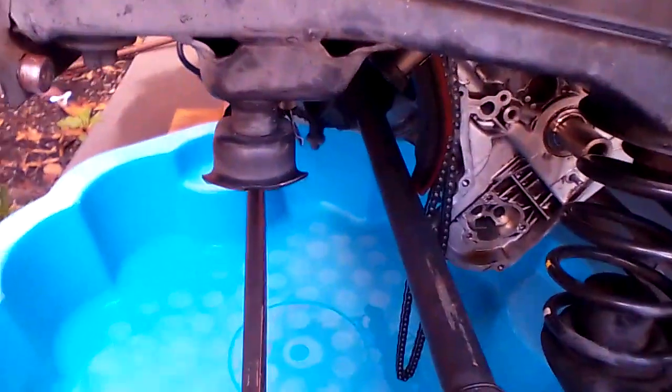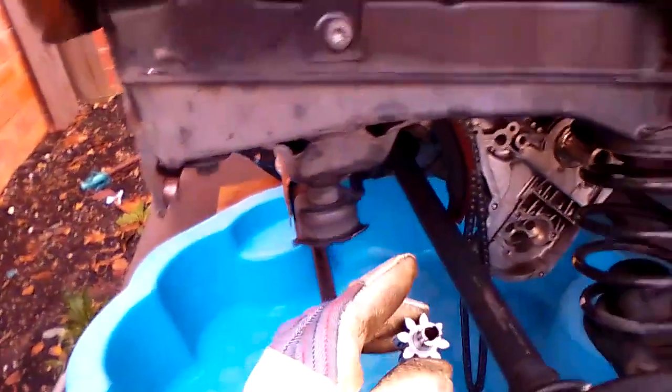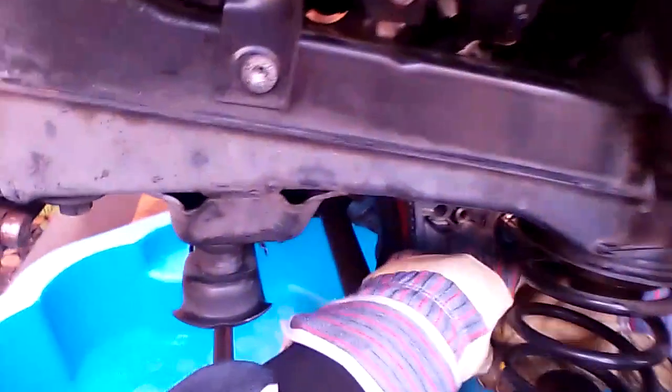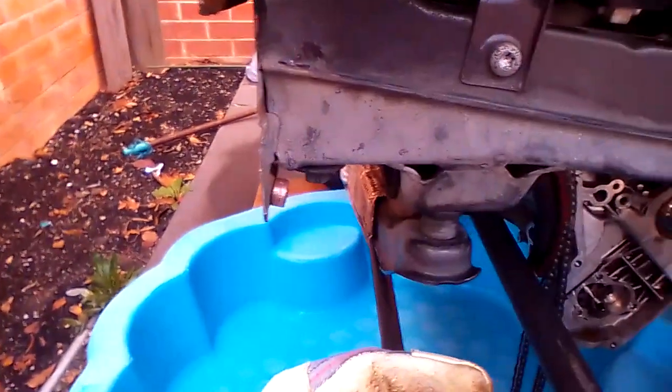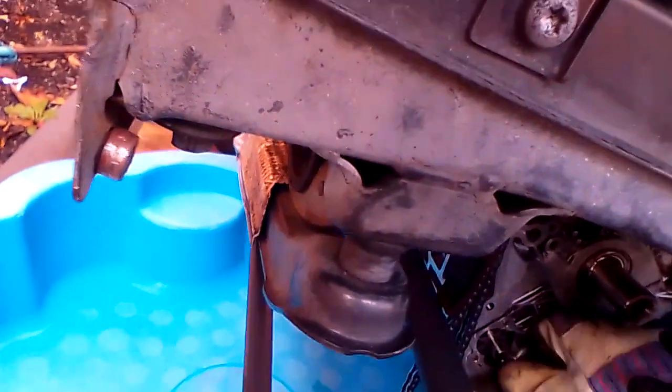Okay, the oil pump. Just going to put it back together. The oil pump is located here in the car, and what it is, there's two sprockets. This one's got to come facing out on the furthest side, like so, and the second one's longer than the other. The longer one goes in, obviously, so it's not extruding out.